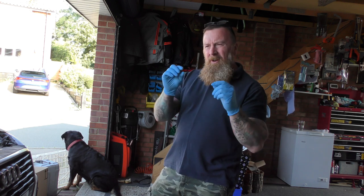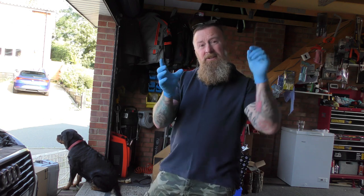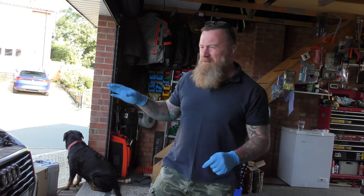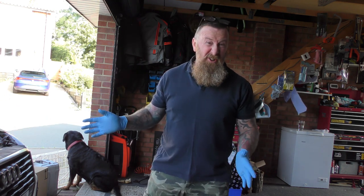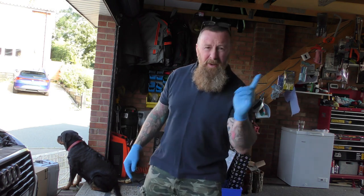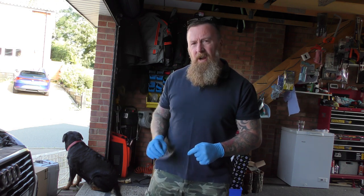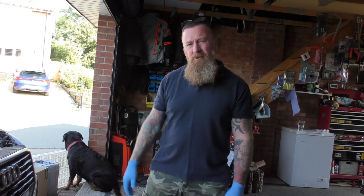And the BMW — they've got a star-shape spark plug now. I mean, why? You have to have an elongated socket to get in and down the back. I haven't checked this out yet; who knows, it could even be the same. But we're doing a basic service on the old car. These little 1.4 engines chuck out 140 brake horsepower — that's a hell of a lot. If you think the old 1.6s, even the XR2i in years gone by, used to chuck out 112. And that little EcoBoost can be 100 brake horsepower from a one-litre engine. Brilliant. They do go wrong, but if you look at old cars never serviced, they went wrong. As long as you do oil changes regularly, you're going to keep your car going. Spark plugs can do 20,000 to 40,000 miles now — so much better. But your oil and filter needs to be changed regularly, and it helps doing your air filter as well.